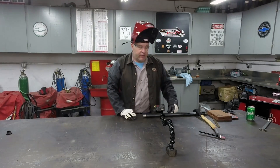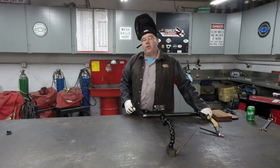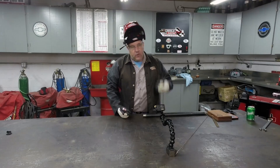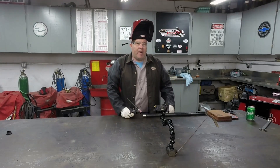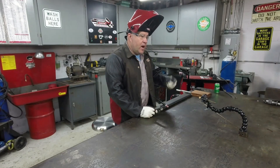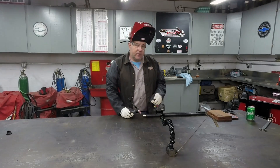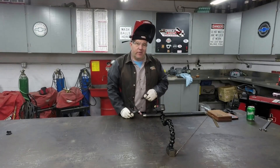It's time to get down to the meat of it and get a little TIG welding done. We're going to lay a bead all the way around both ends. Got a nice chamfer — nice deep V. Our filler metal is ER70S-6. We're going to be running DC electrode negative — we only TIG weld in DC electrode negative. Machine set on about 150 amps. We're going to get down in there and lay a nice bead about a third of the way around, rotate it a third of the way around, and a third of the way around. Before I actually start laying bead down, I'm going to put a couple of tack welds on both ends. So it's getting late — let's get to this and get it done.